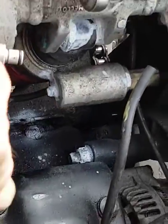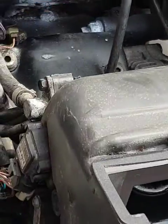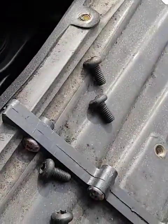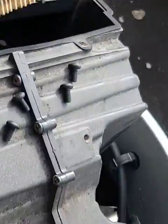All I need to do is take the tank off — just these connectors, or you could lever the tank up without disconnecting anything. Then take out these four air filter screws — it's just one of these Torx drivers — take the four bolts out, blow the crap out of the way, pull out the air filter, which looks like this, and you're done.